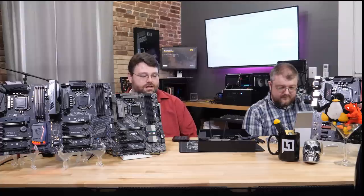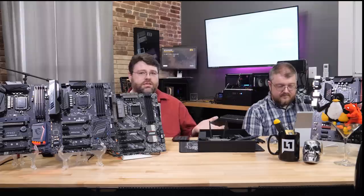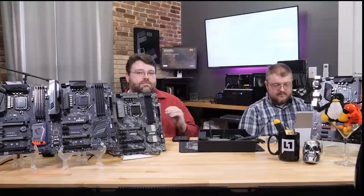I'm very surprised. Think about it from a vendor perspective. Motherboard manufacturers rolled out Z270, a brand new chipset, only 10 months ago. And Z370 is not backward compatible. So that's basically, quote unquote, obsolete. Now, to be sure, a 7700K is still a really top performer in terms of gaming performance and single thread performance. But now you can have a 6-core 7700K, if you will. The performance and the characteristics are very similar. The clocks, you can't achieve clocks quite as high on average with the i7 and the i5, but you're close.